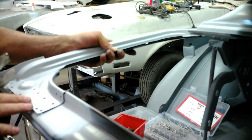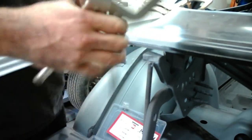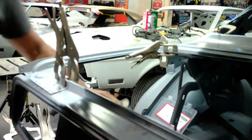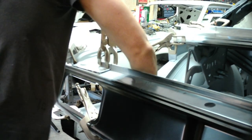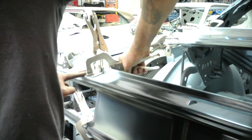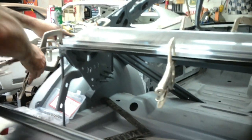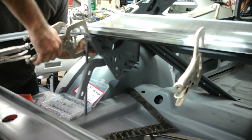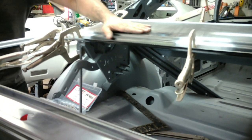I had all these parts together already — that's why everything's going together so smoothly. I had to modify these trunk gutters a lot because they weren't following the curvature they should have — they were too far straight, so we had to arch them down a little bit. You're going to find with a lot of panels that you're going to have to push, modify, and bend them to make them work. I'm not completely setting them yet because we've got side-to-side movement that's going to be determined by the trunk. We'll clamp it down, take some measurements before we put the trunk on.